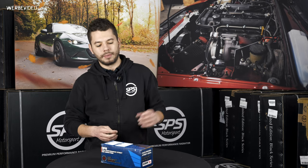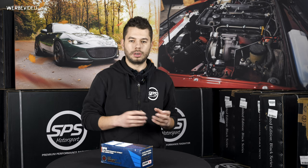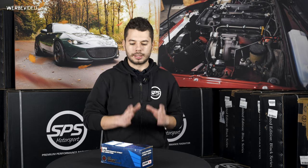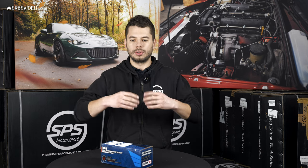The HPS is called by Hawk a high performance street brake pad. You can use it on the street and it will deliver good performance. The cold braking situation I explained — this pad handles it pretty well and doesn't need too much temperature to get into its working area. It gives more or less good brake performance when brakes are cold, and it does not make noises if everything is correctly installed. These pads have a higher working temperature area than the stock OEM ones from Mazda, giving you a more sporty brake pad without a very big loss of comfort or street usability.